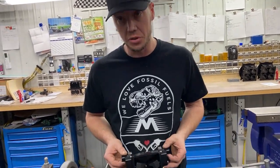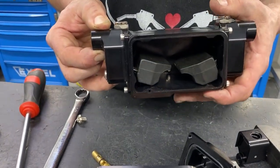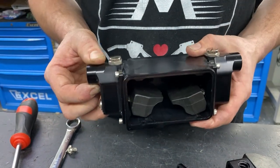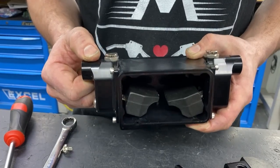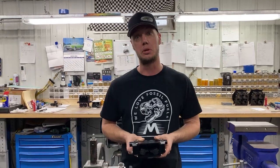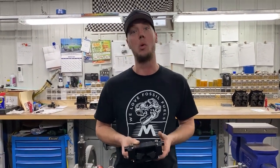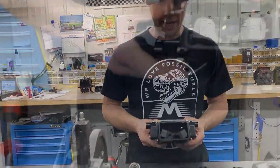These do run fairly high pressure. Keep in mind the blow-through is a sealed unit, so when an application like this has 20 pounds of boost it's seeing somewhere between 35 and 40 pounds of fuel pressure — we always have to have more fuel pressure than boost in order to not blow the fuel out of the float bowls. We had a display at PRI with a standard float bowl and our bottom feed float bowl, both at the same fuel pressure on a shared fuel system, and the foam in one versus the lack of foam in the other is really astounding.